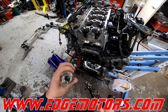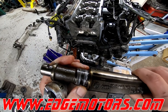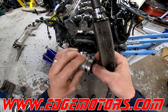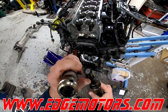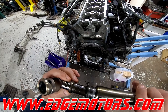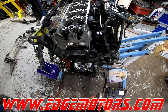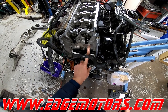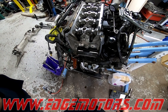And this is the actual problem that we had with this motor over here. See the bearing on the balance shaft that drives the water pump — it went bad. We broke it off to see what's going on inside. So there you go: pressurize this hole over here and make sure it keeps pressure. If it doesn't, don't bother putting the timing chain back on.